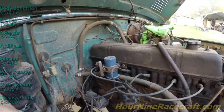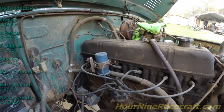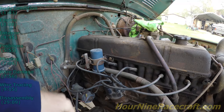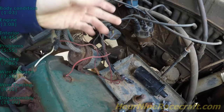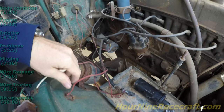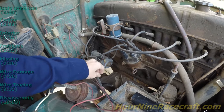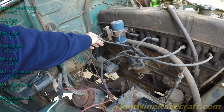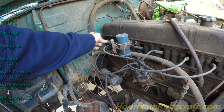Following the rest of the wire harness — there's a red wire that goes into the interior and probably goes to there's an oil pressure feed line just under the middle of the dash, so that probably powers that. There's also a red ground wire — I hate it when people do that — a red ground wire, and it's not even factory but it mounts there. Coming out of this part of the firewall there's a black wire with a yellow stripe that goes to the ignition coil.